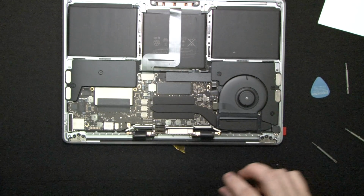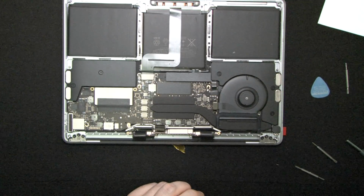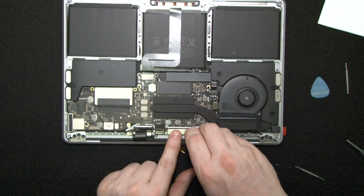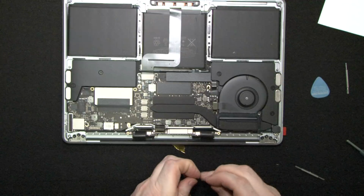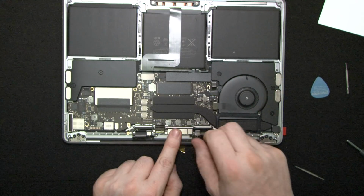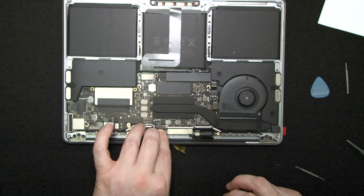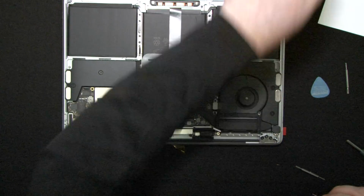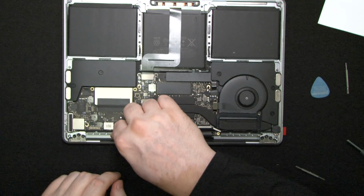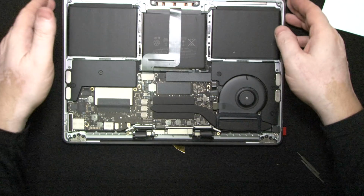You do not want to finish the job and then discover, well, there is a problem with the LCD. Ooh, jumpy. That's one thing you don't want happening. That could short circuit something for you and cause damage that you don't want. Okay, so just snugly put it in. Let's reconnect our LCD cable. We'll put another screw into here. Remember, we still have to put that antenna board, but we don't need antenna board to just test things out. So let's see if it works.